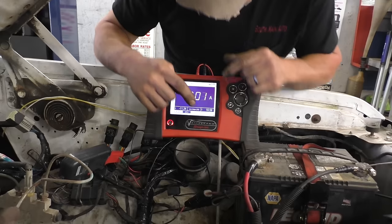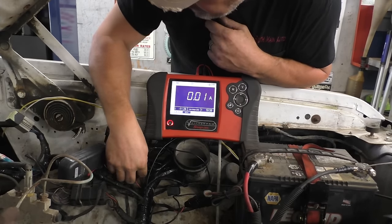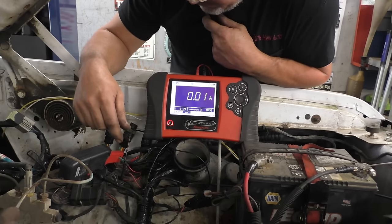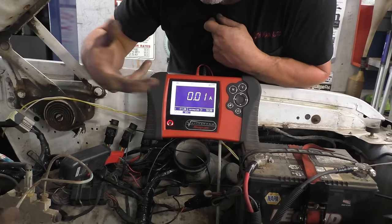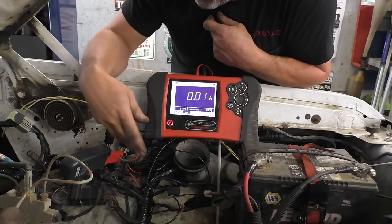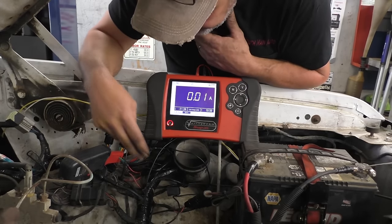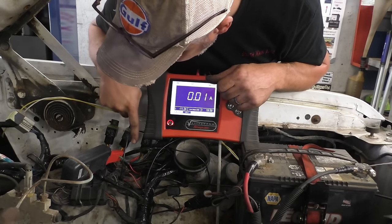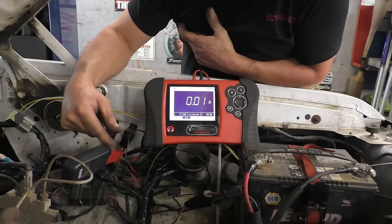Dodge Thunder. So the maximum amperage we hit is 20. Probably would be a wise bet to put a 25 amp fuse, just be slightly over the rating. Really the current draw shouldn't get any higher on that unless an injector shorts or the ignition coil shorts or, you know, any of the wiring shorts. We're still protected at 25 amps. We'll just have to look at what size wire that is, just to make sure that we're still good in that regard.